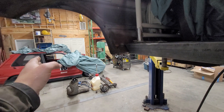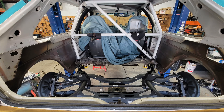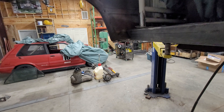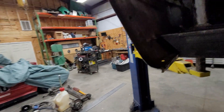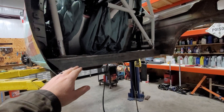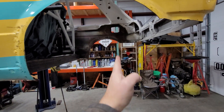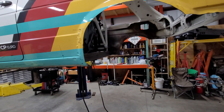I'm also adding about two inches of wheelbase — this is around a 97-inch wheelbase car and I'd like to get it to an even 100 inches. I think that's going to help stability, and I can tune it out at autocross with a bigger rear sway bar, smaller tire, or more tire pressure. On bigger tracks, adding stability adds confidence, and I really think that's a faster way around the track for me — especially having confidence under the brakes. The position of the rear wheels will be just off-center, somewhere around here with the new rear subframe and box beam position.